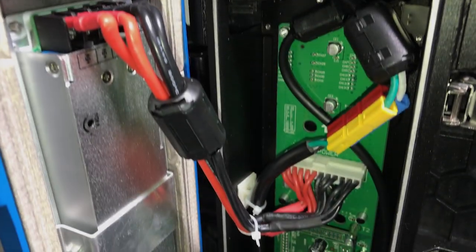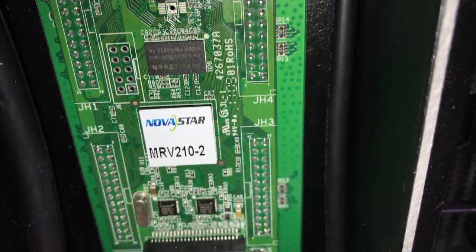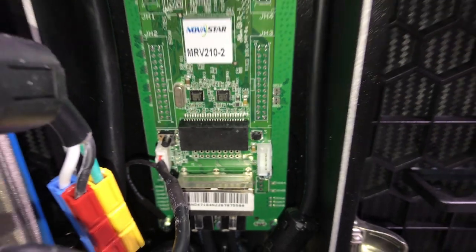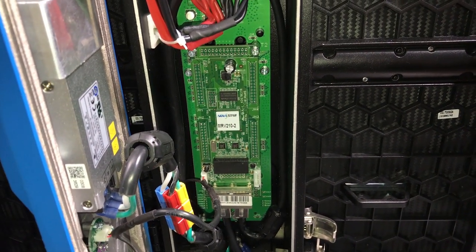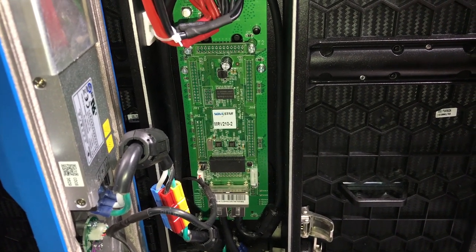On the left-hand side inside the panel we have a self-contained power supply. On top of what's called the LED PCB hub is the receiving card — basically the motherboard of the actual LED wall. In the Nova software you'll see where it says 'send to card' and 'receive from card' — that's this component right here. This is the brains, the brawn, everything.